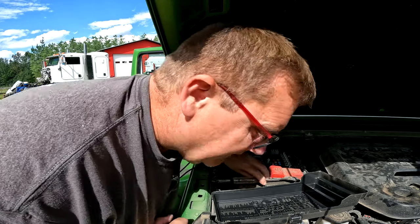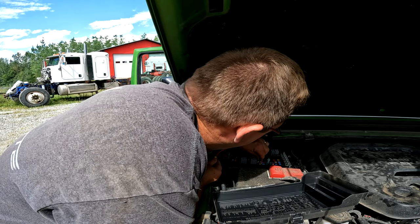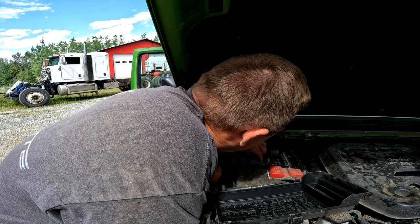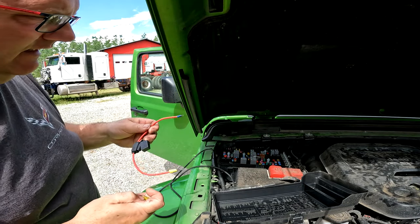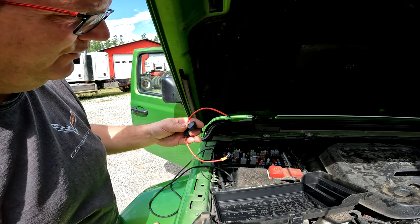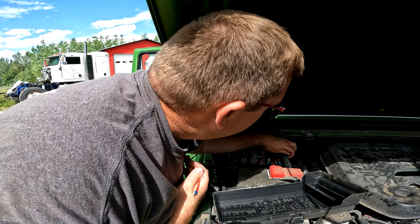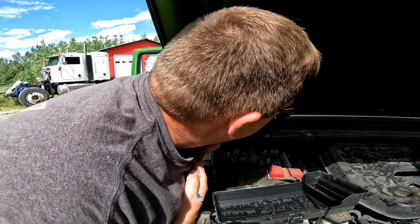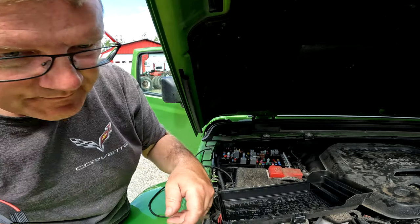So this side is the signal. Now, I've made a jumper wire that can plug in to this one side. Now, I'm gonna have to trim this because this, of course, is a little too big. I also have a 20 amp fuse to go in this, and we're just gonna pick up power from a spare bus connection right there. Will it work? Oh yeah, that'll work just fine.